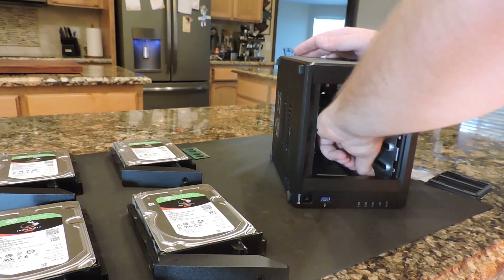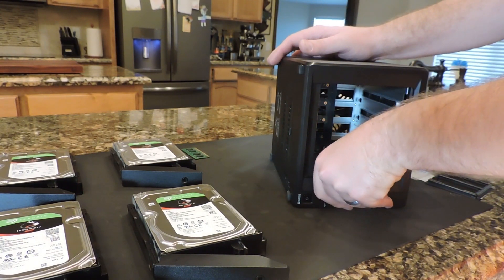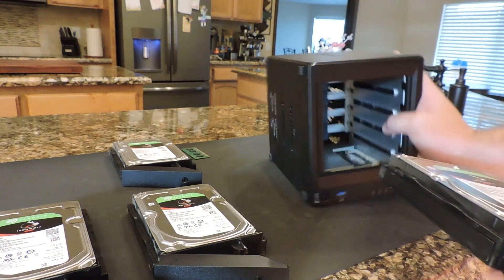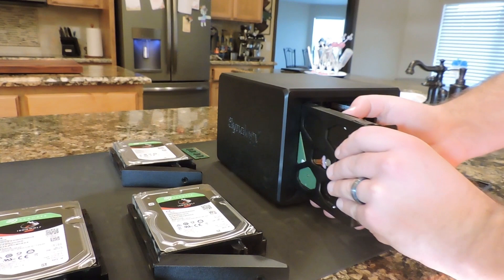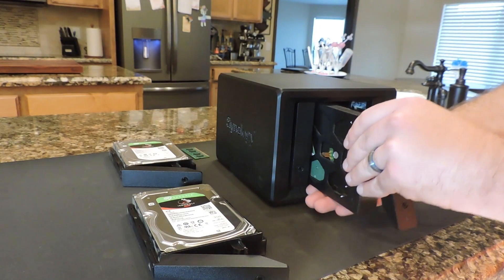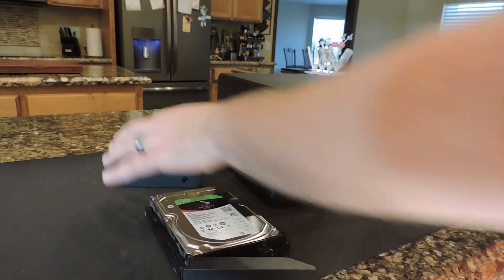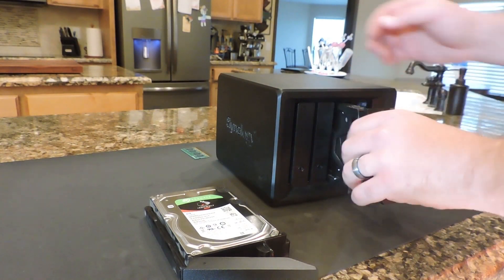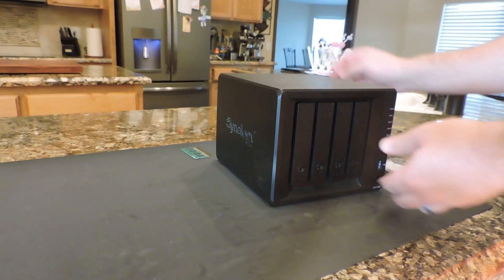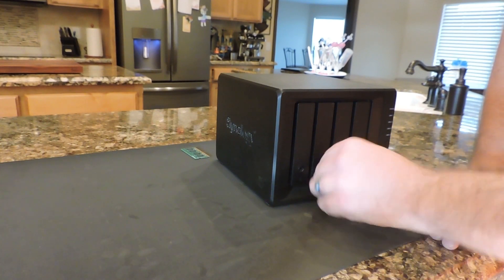Now we'll reinstall the hard drives. I don't think I got that fully seated, so let me just loosen it up — you just pry those two tabs out, push it down a little bit, and then it locks in place. I'll put the hard drives back in the order I pulled them out. They just slide in. Once you get it fully seated, push down the lever, slide in the drive next to it, and keep going until all four drives are in. Then take the key and lock each drive in place to prevent anybody from accidentally pulling a drive out.